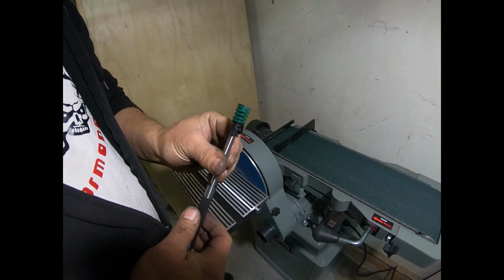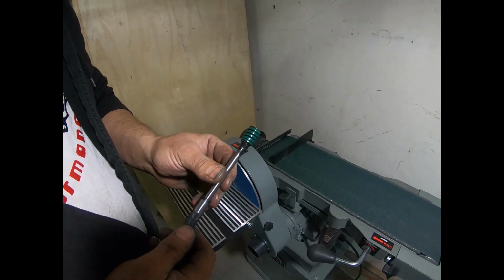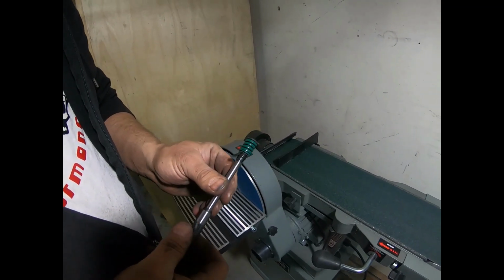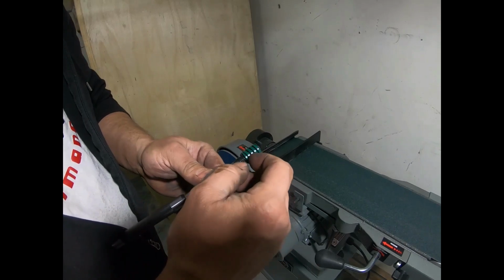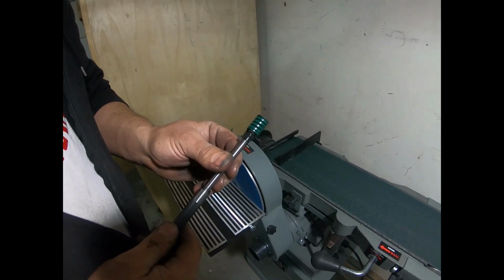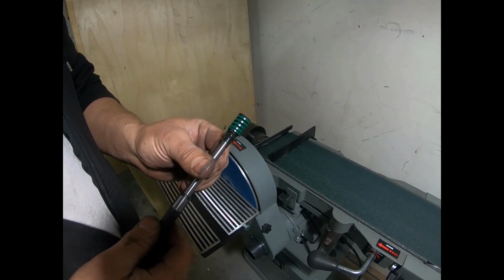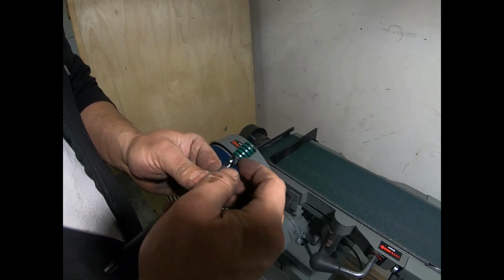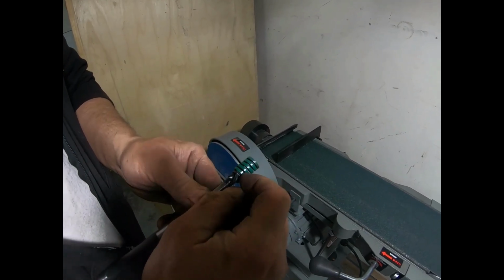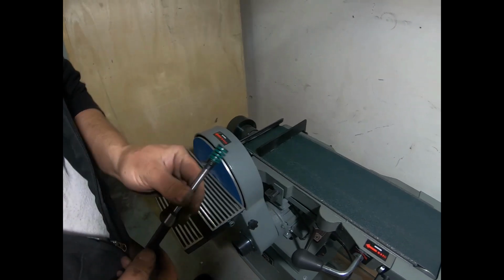So with these green springs on the SAF Super Clutch, because of the difference in pad size guys use and the thickness of it, they need to be reduced down. These ones are going to be the stock pads that I'm putting on there. So this I'm going to have to take down from 20.5 millimeters in length, and I'm going to take it down to 18.6.